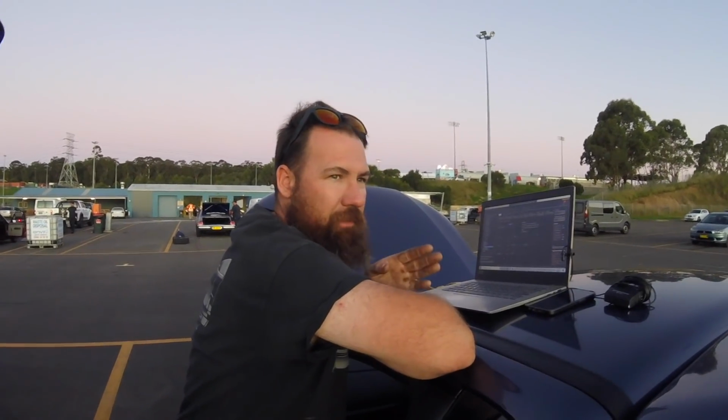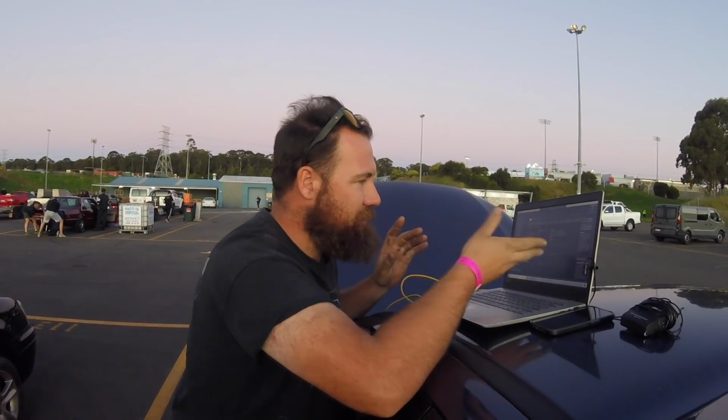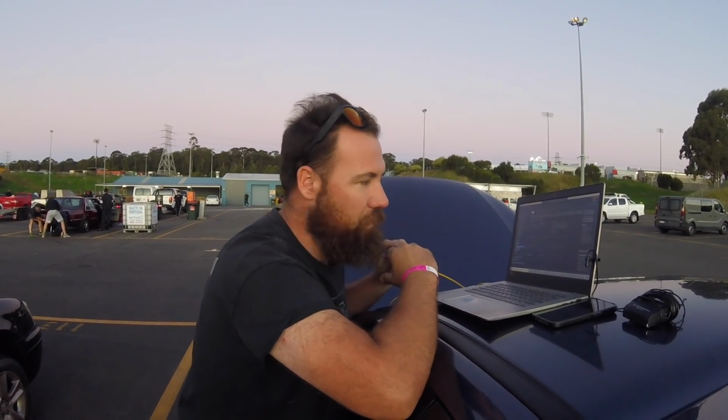my idea behind this was that the ECU already sees all these buttons via CAN because the cruise control is controlled via the ECU. It's not a separate cruise control module in this car. And already having those inputs into the ECU, I thought we might be able to adapt their functions. And in this particular case, it's worked pretty well.